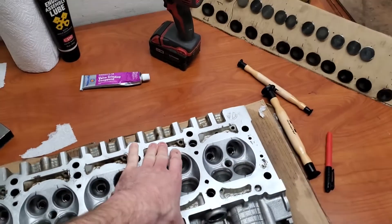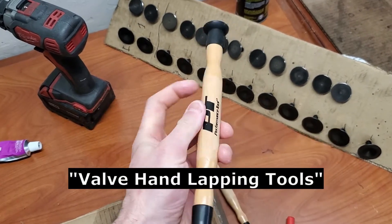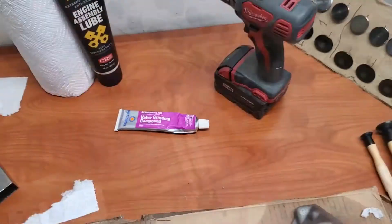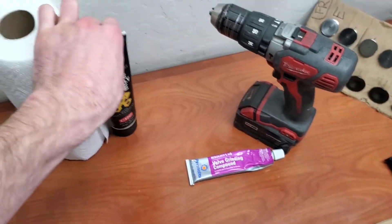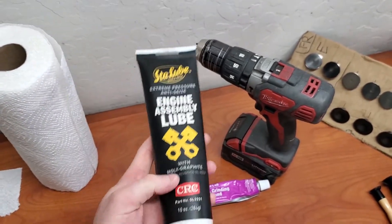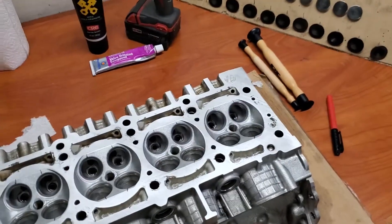Here's what you're going to need to redo the valve seats. First, you're going to need these hand lapping tools — this specifically is by Performance Tool, but I'm sure any good ones will be fine. Then you're going to need some valve grinding compound — this is by Permatex — and some engine assembly lube, which is by Stay Lube CRC; it's moly graphite. Not sponsored by anybody. So that's what you're going to need for this job.